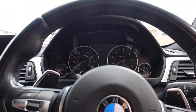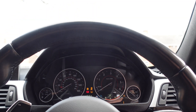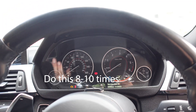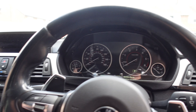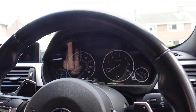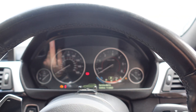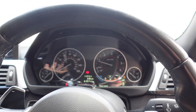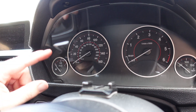Now I'll try and start her up. What you want to do is make sure your foot's not on the brake, then press the start button — that's going to prime the fuel pump and hopefully push a bit of fuel into that fuel filter, because there's going to be no fuel in that filter initially. Do that a good few times. Let's try it — it might crank a few times just to get fuel in. If you've done this and your car's asking you to service it, you'll want to reset the light.